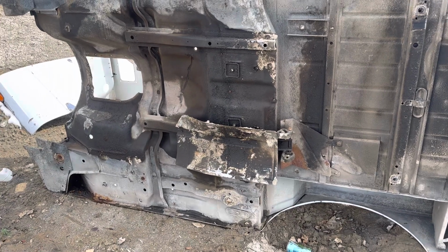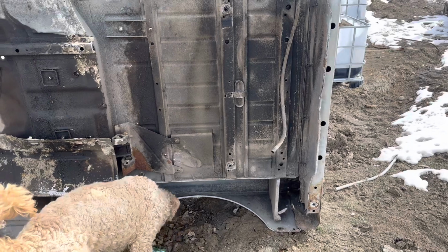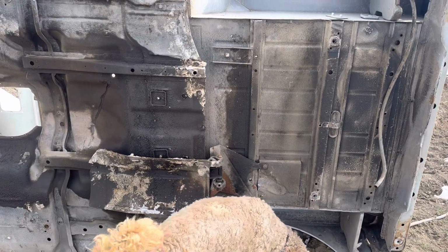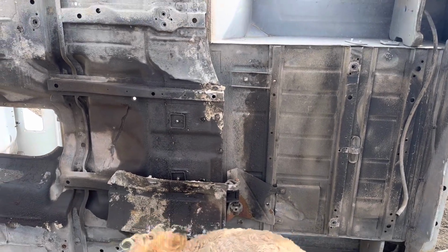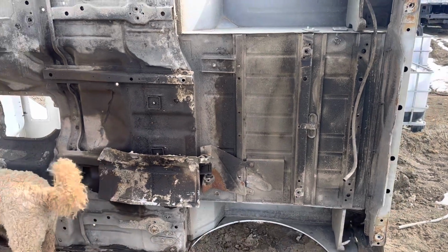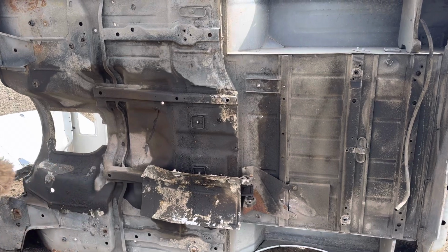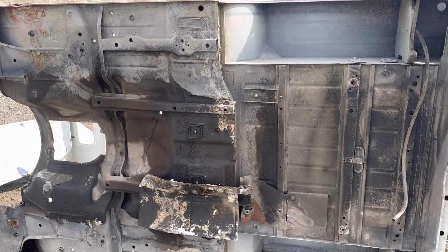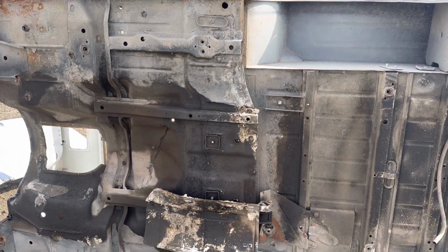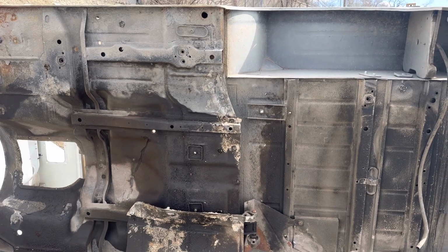And the one thing that people usually don't like to replace is torque pockets, because there's a fair amount of requirement to do them. First off, they're boxed in areas, and I'm going to get up close here in just a second. They're lapped sheet metal. They're spot welded, and not just a few times. A given pocket could have 40 spot welds on it. So they're extremely difficult to cut out.